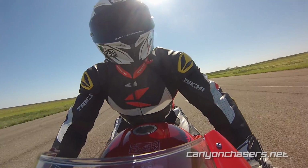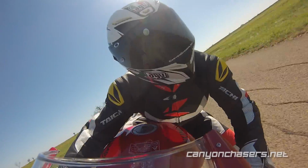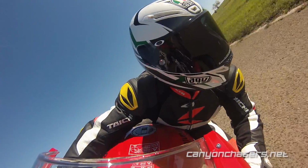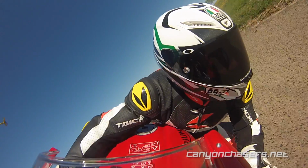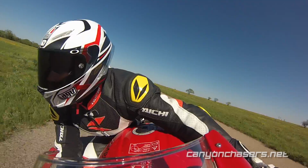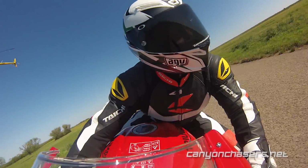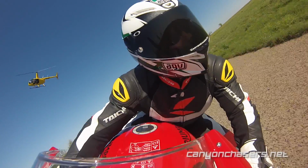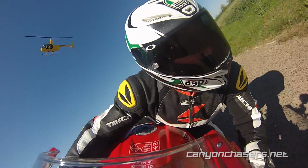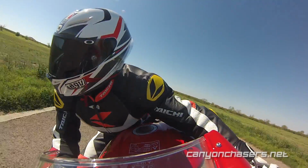Now the front tire has changed from the Sport Attack 2. The initial tip-in is a little slower than the older version, but it's still very stable and planted while leaned over. So the tire is a little slower through these fast kickers, but again, more stable. This also makes the tire more forgiving of any sloppy handlebar inputs. So the softer carcass is really compliant. It makes this a very agreeable tire to get on with.